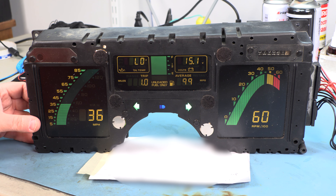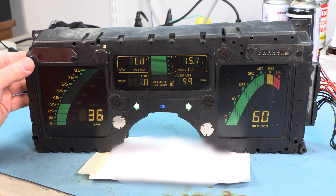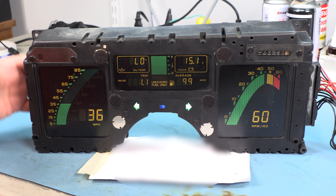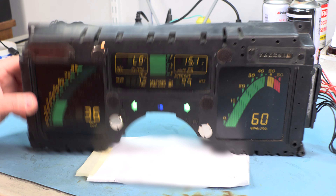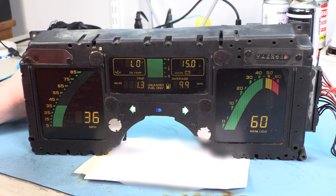I've taken the back off the cluster. We're going to push on the power supply — I don't see any intermittent operation so far. We're going to push on the 12-pin connector set, again looking for intermittent operation. We'll bump it on the bench. So far it looks stable. Let's take a look at the circuit boards.